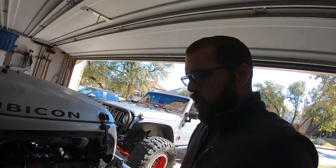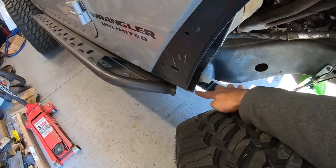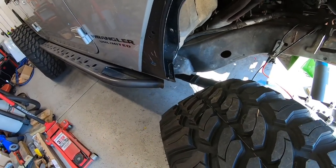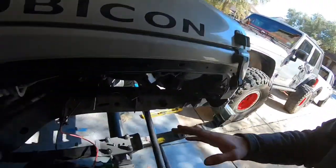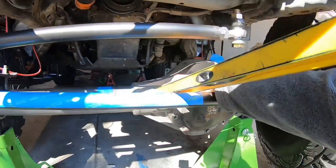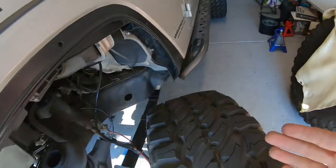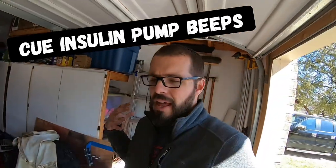So what I'm going to do is stand on the front edge of the tire, put my body up against it, and look at the corner of my fender. Knowing that both fenders are straight and the vehicle has never been in an accident, I'll turn it back a little bit so it's basically in line with the center of the tire. That won't make it turn quite as well as it could, but it'll still turn pretty well, and it backs it off the leaf spring enough to avoid any issues. I mark the tie rod again the same way, then turn it the other way and do the same. To the driver's side — same steering angle, corner of the fender right on the center of the tire. We have equal steering left and right.